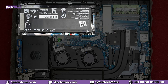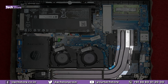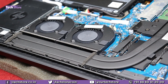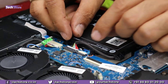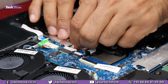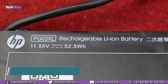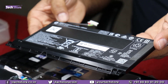Here you can see the SSD slot, the RAM bay area, the hard disk bay area, the battery, the keyboard connector cable, the touchpad, the VGA cable connector, and the entire heatsink with dual fans. You'd have been happier if the fans were placed farther apart instead of together. Let's start with the battery — remove the screws and pull the connector out. The battery model is PG03XL, rated at 11.55 volts and 52.5 watt-hours. We would have expected a larger battery given the processor and graphics card.